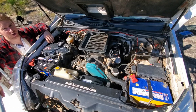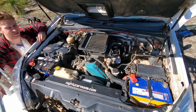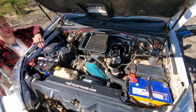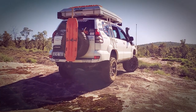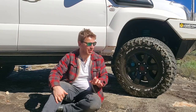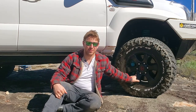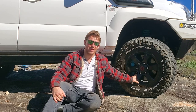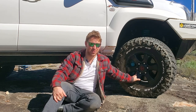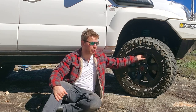At highway speeds that drop in intake temps allows you to overtake much more easily — if you drive a 1KZ you know overtaking on the highway isn't always an option. For wheels, I'm running the factory GXL alloys — 17-inch rims, seven and a half inches wide, around a plus-25 offset. I really like the look so I've kept them, painting them satin black myself with rattle cans and satin clear coat. Easy to touch up with spray paint when they get the odd scratch.